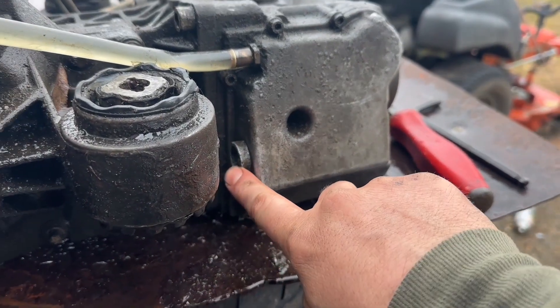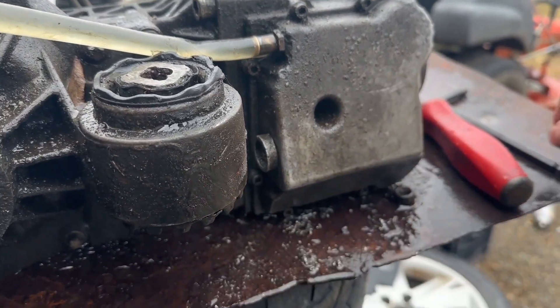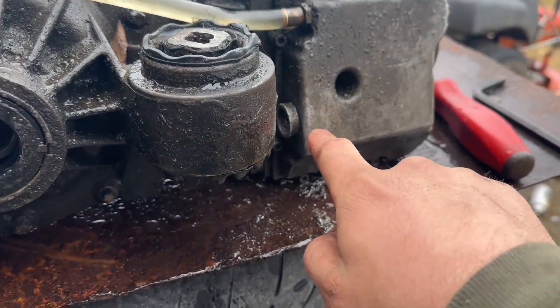Since you've replaced your CL piston and done the clutch pack, it's really worthwhile to do a full rear differential service while you're right here. Make sure you do your research on this — there is a service bulletin where you have to add extra fluid through the top port. I finished servicing the rear diff and installed it back in the car. Unfortunately, somewhere in this process I broke multiple points in the rear harness and couldn't find the spots. I had a TCS and ABS light on, which effectively meant I couldn't transfer any torque to the rear of the car and couldn't test the clutch packs.